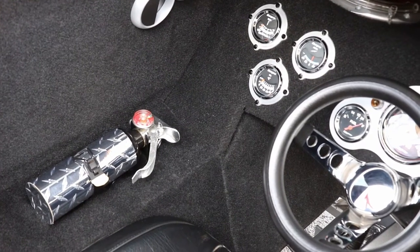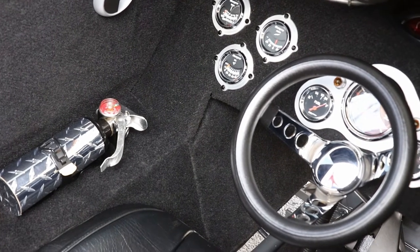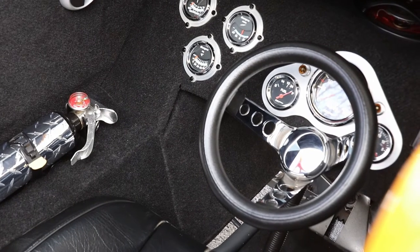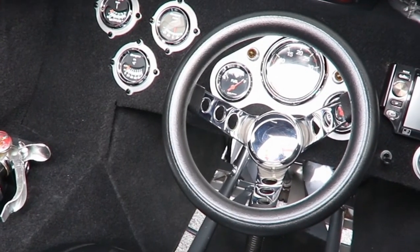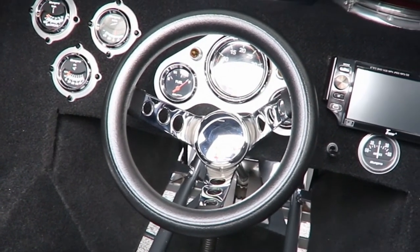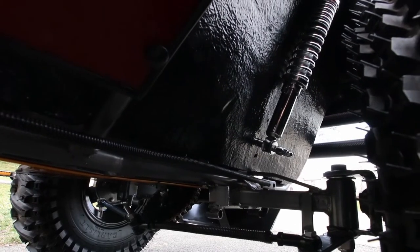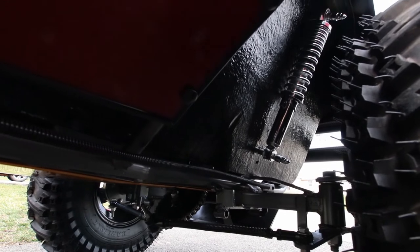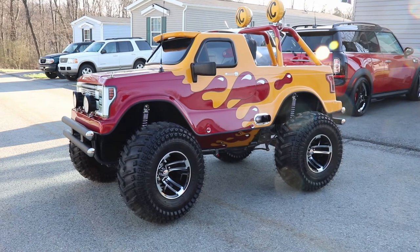I can't help but notice the small steering wheel. Mostly it's because you have to get in and out of it — I had a Grant GT steering wheel in there once and it kept hitting my thighs as I drove. I went with a small dune buggy style instead. It's actually not hard to steer because they made a gear reduction for the steering — instead of a typical rack and pinion, it has a chain drive that acts like power steering.